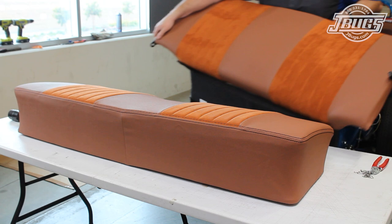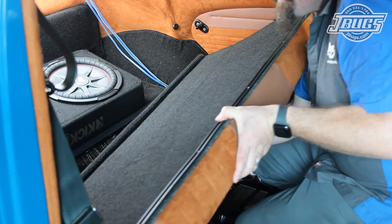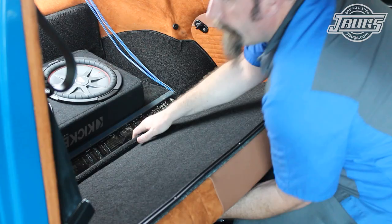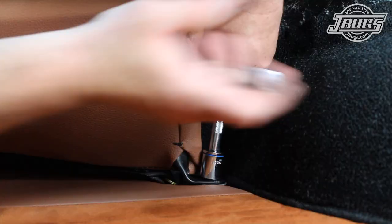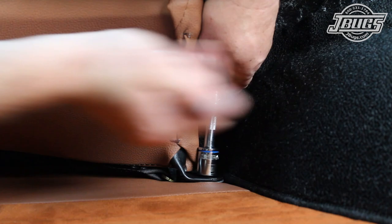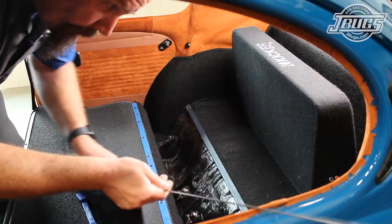The seat is installed in the car, backrest first, by setting it into place and then bolting it into either side of the body below the quarter panel with the original spacers and bolts. The spacer installs with the larger edge towards the seat, and once both sides are tight, the carpet flap can be pulled up and over the lip at the luggage shelf.